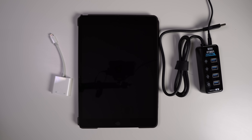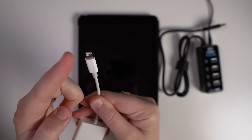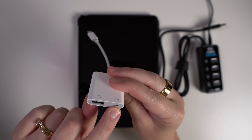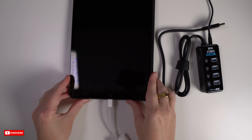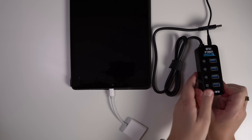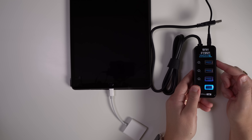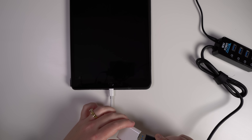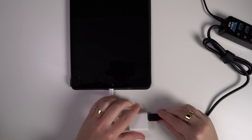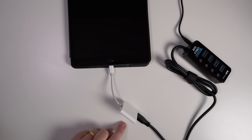I'm going to be using an iPad for this demonstration because I don't have an iPhone with a lightning port, but it's exactly the same with an iPhone. The things you're going to need are an adapter with a lightning port connection on it — on the other end it has USB-A. Connect this into your phone or iPad. Next you will need a powered USB hub — this cord is the power connection plugged into the wall socket powering the hub. You can see each USB port can be turned on or off. Plug the USB from the hub into your adapter — this is pushing power straight to the iPad, which is needed because lightning ports can't power a hard drive the way USB-C ones can.